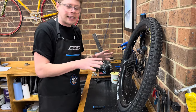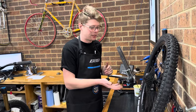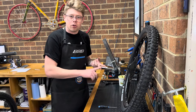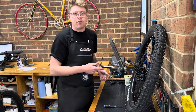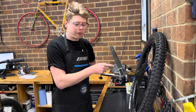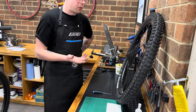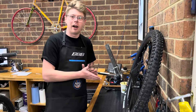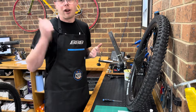When these are freshly cleaned and lubricated the sound will be a bit quieter, and then it will progressively get noisier as it works towards requiring another service. This applies to the DT Swiss Star Ratchet found on 350, 240, and 180 hubs — but not the latest iteration called Star Ratchet EXP, which we'll cover in another video. If you've got a DT Swiss rear hub with a Star Ratchet, you can try this yourself. Typically do this two or three times a year with each service. If you do a really muddy race or ride, you may want to pull this out as a preventative maintenance item. Put the wheel back in the bike, make sure it engages correctly, and go hit the trails.